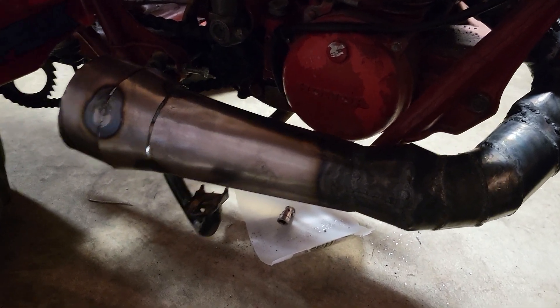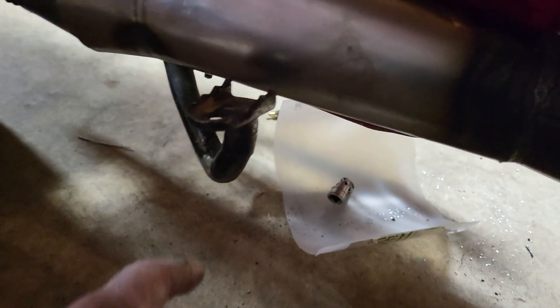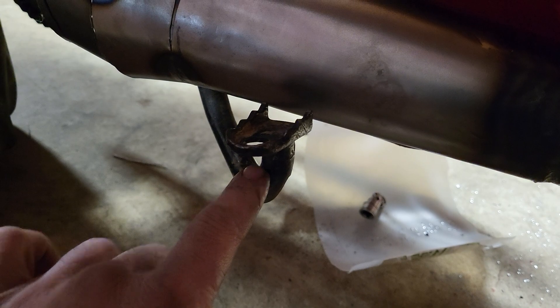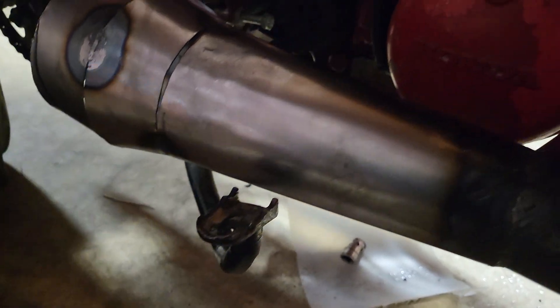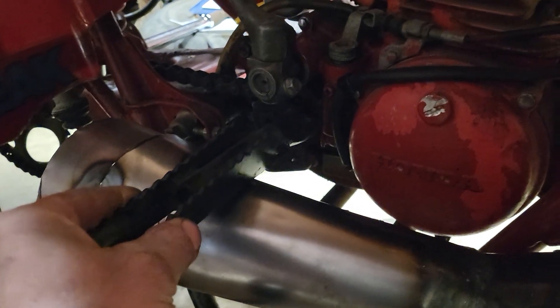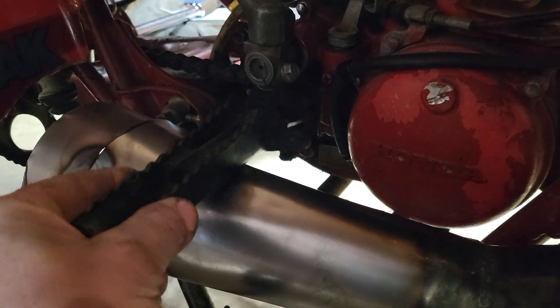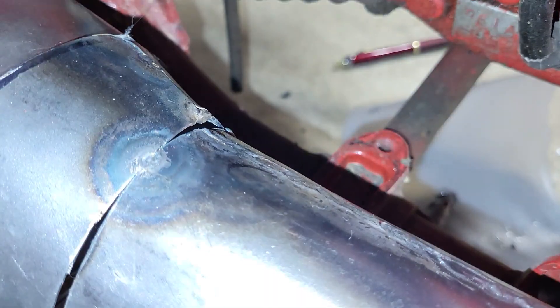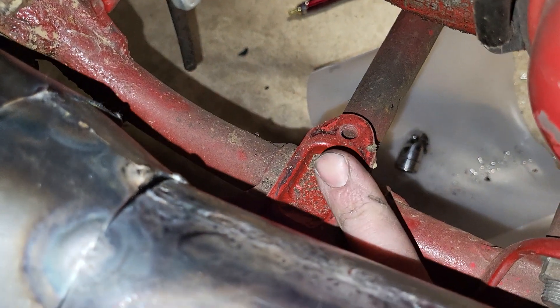So I had to stop. The brake pedal has been cut — you can kind of see it's a bit weird here. I'm going to cut it there again and add the piece I need to get it up. The problem is the foot peg has to sit up here, and I don't know where I need to be with the kicker and the pipe. I think the pipe's a little too high as it is. It's got to sit on this bolt flange right down here. Now we can see it — there's the foot peg bolt.